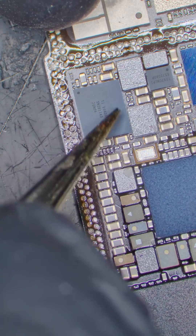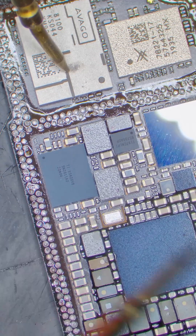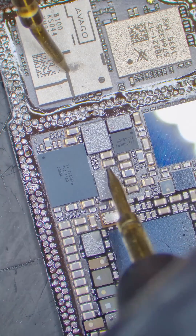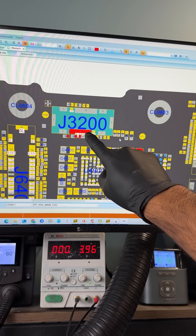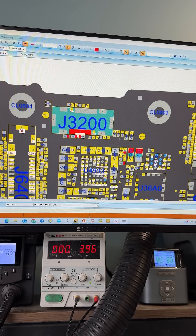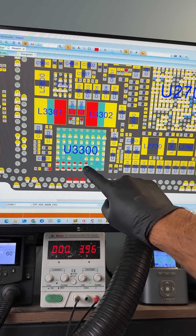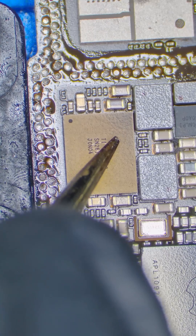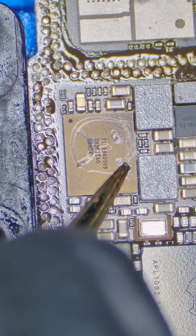The first thing I like to do is check the connections around the power management chip. This chip takes electricity from the battery and sends it to the rest of the board. We actually find a line that's reading abnormally high. The battery plugs into the connector, then sends power to this chip — and our diagnostic tells us this chip is not functioning properly. Essentially, we have a sad chip.